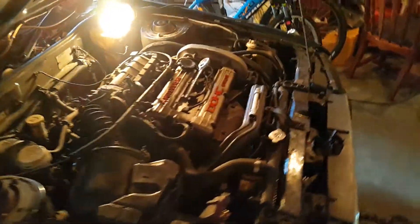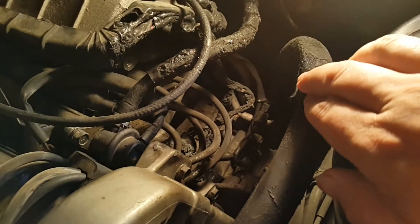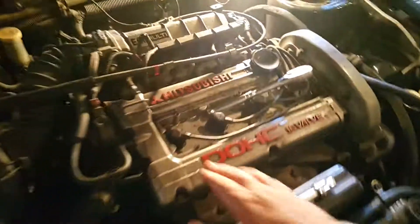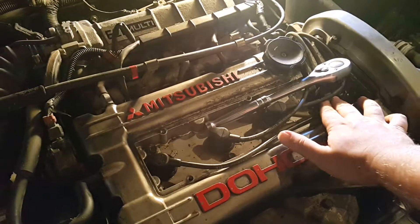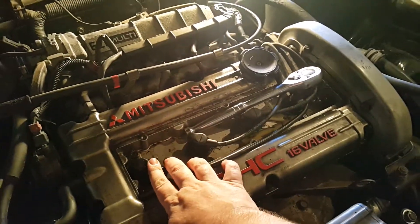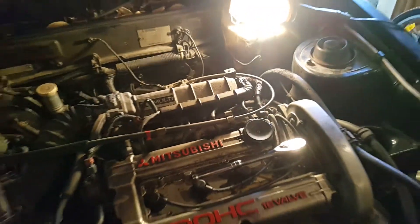This is the car we got. When we went and tried to start it up it caught on fire, so all these wires here are all melted, but it's not too bad. When it runs it doesn't run very well. Found that that spark plug and that cylinder weren't firing, so I'm pretty sure the coils are messed up. I've got to pull it out — I'll start it up.